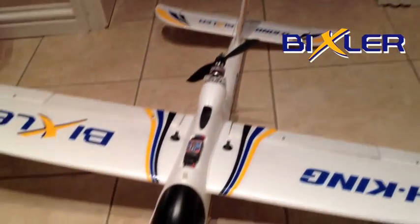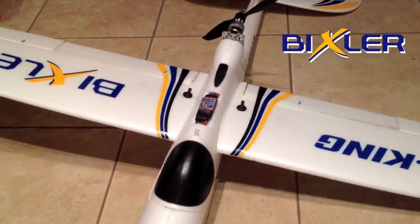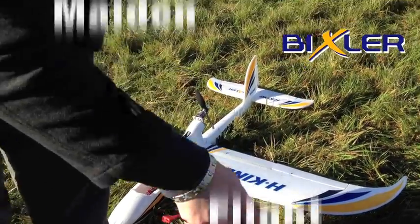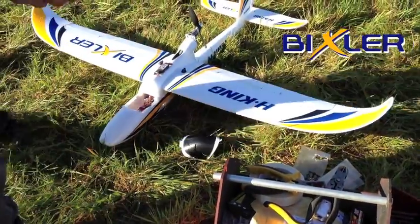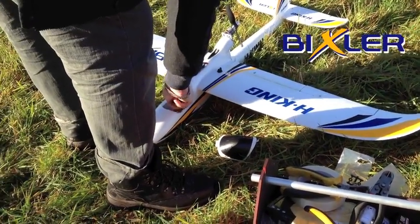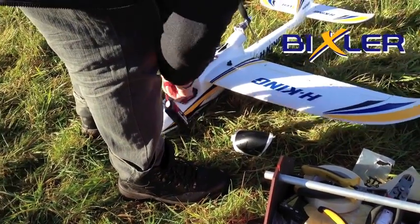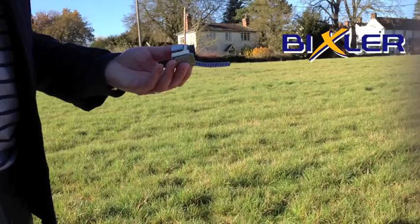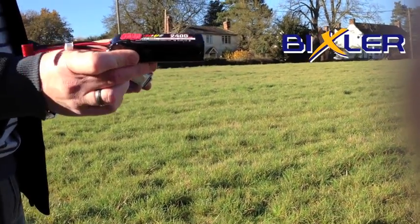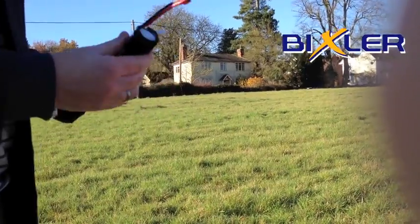I think they are ready to maiden it tomorrow. That was battery three — I want to put a fresh one in and then go up and put 20 minutes on the clock and see how we go. This is all the nose weight — 60 grams. This battery weighs 200 grams — a 2400 milliamp battery — just to get it to 70 millimetres for the centre of gravity to balance, but it seems to work really well.